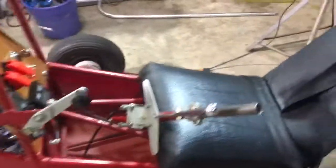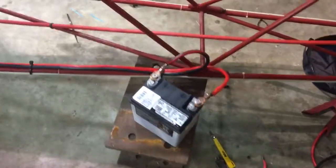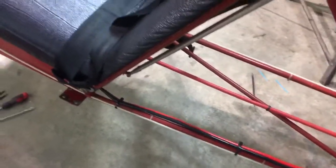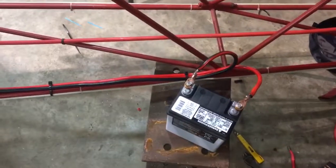The one problem I did have — I wanted to put the battery as far back in the tail as I could because I'm not sure on the weight and balance. With the Hirth engine, gearbox, and everything else, I assume I'm probably going to add quite a bit of nose weight. So I was hoping to put the battery back there, but the six-gauge wire just wasn't big enough to carry that amount of amperage over that distance. So I had to cut it off. If the balance works out, I'll be able to mount the battery somewhere right in here, and if it's still not enough tail weight, I'll just have to add weight to the tail.